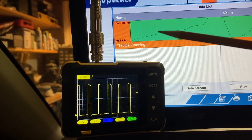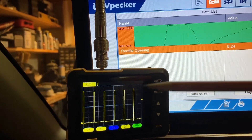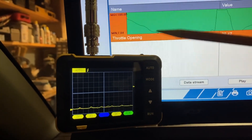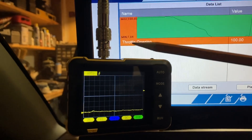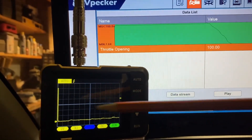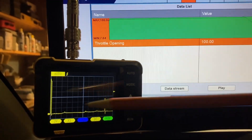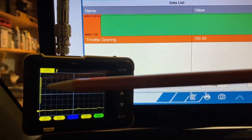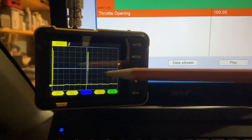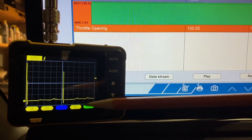Opening all the way — at the fully open position you'll likely see some closed drive come back as it modulates at that 100% position. As I start to close you'll see the closed drive come back; it's closing under mostly spring pressure. But when I lift my foot off the pedal completely you'll see the drive come back quite wide momentarily, because it's actively driving it back in addition to the spring pressure. Keep those two bias springs — open and closed — in mind and this drive makes a lot more sense.